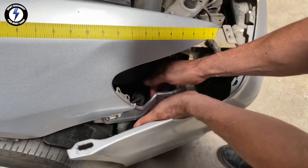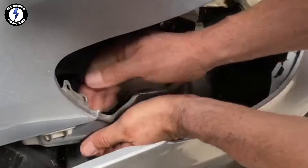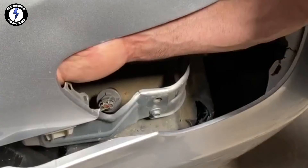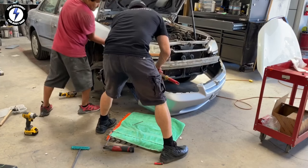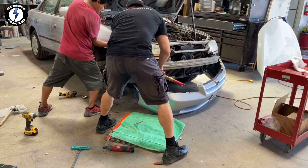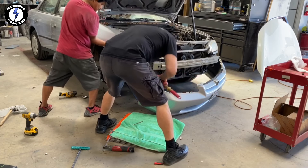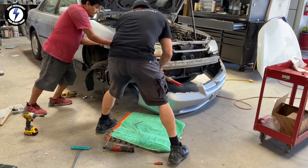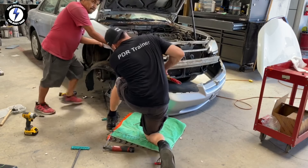I am filling out the damage by applying pressure with my hands to the bracket and the dented area. I'll need to use my auto body slide hammer on the bracket, giving the slide hammer several strong pulls. The bracket wasn't moving so I had to find a new location to place my hook. After several attempts and 15 minutes later, we got it pretty close.